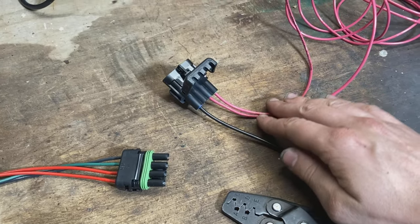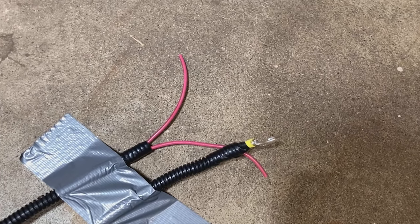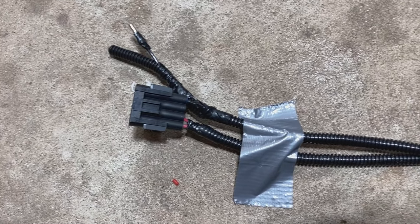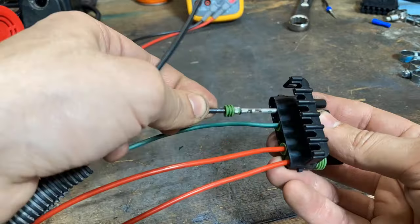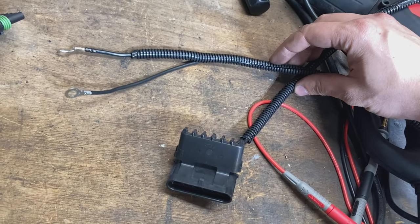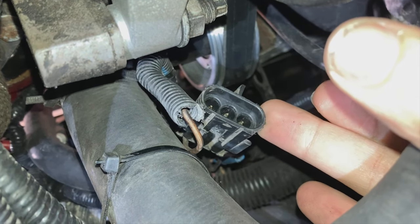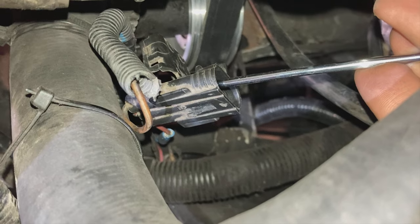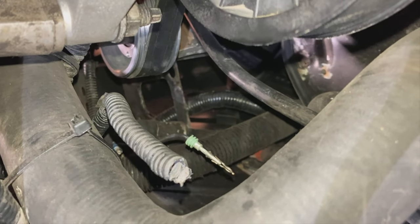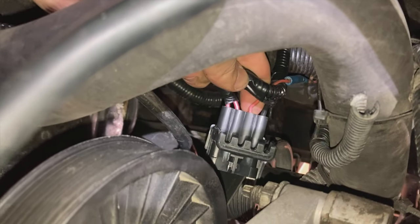On the end of the weather pack connector I'm going to put this relay pin with two 14 gauge wires. Since this is a pull to seat connector, I'm going to have to pull these wires through the relay first and then pull it into place. Part way through I realized I should probably just go with the 6 pin connector instead of having this extra ground connection going outside of the connector, so I deep pinned the 4 pin connector and ordered a 6 pin connector. On the car side I'm actually going to deep pin this old 3 pin connector and reuse some of the pins. First you must pop off the block on the back of the connector and then you can release the pin. I cut down an old radio antenna that's the same exact diameter as the tool needed to release this pin — it works like a charm. I am going to reuse this fuel tank level wire, which is the reddish wire coming out of the middle of this connector. These are the same exact connectors, just one has an extra pin, so we'll just stick it right in and it'll click right into place.